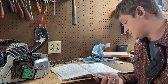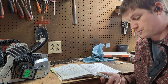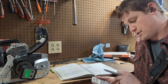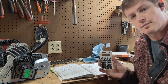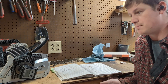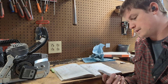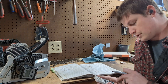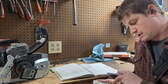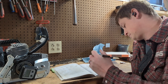So we now have an intake and exhaust of 86 and 95.3. We also measured our blowdown at 22.8 degrees, so from there you could just add 22 to 95 and get 117.3 mathematically. But we measured 123.6. This is a good example of why measuring ports is somewhat of an art — there's a lot of variance in how people do it. So taking 360 minus 123.6 divided by 2 gives us 118.2.